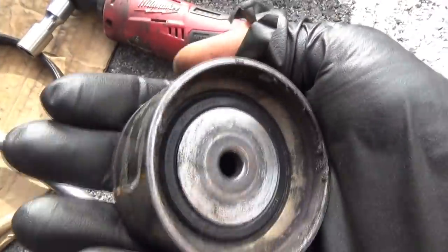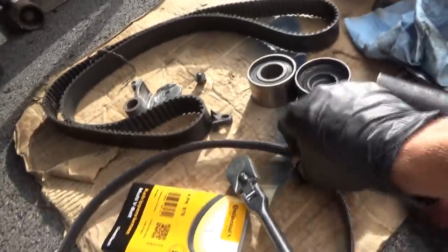So what did we learn today? You got an engine with a timing belt — non-interference is the way to go. Even if you religiously change your belt every 60,000 miles, stuff can still happen. Components — we got the Continental kit, good components, as long as it's not made in China. And if your mechanic recommends that you change your timing belt, it's probably a good idea to listen. A few years ago she's like, 'Oh yeah, it's been done recently' — well, recently turns out to be 2007, 14 or 15 years ago, like 70,000 miles ago. So that bearing — yep, it was OEM, made in Japan — seized solid. There's the carnage. Keep your old cars on the road — see you next time, bye bye.